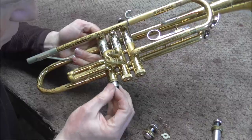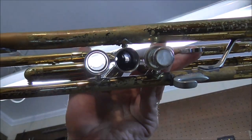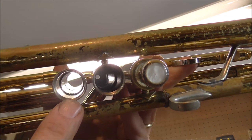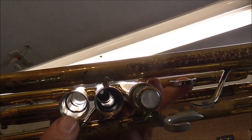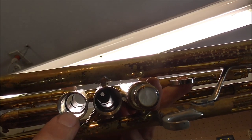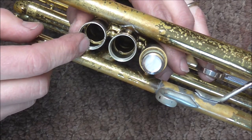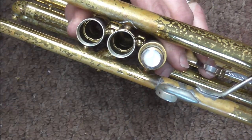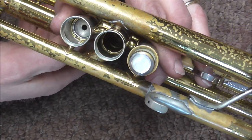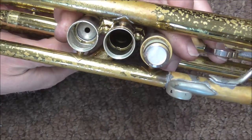It does get stuck. I'm going to point the camera up to the light and show you inside the casing so you can see what is going on. See how there is a larger bore and a smaller bore inside the casing — the larger bore at the top is made so that the valve guide can fit in there. But when the valve guide hits the smaller portion at the bottom, the valve guide catches on that, and the valve guide and spring work together to make the valve go up and down. What I think happened is right at the top of the small portion of the bore, it was shrunk in, and it's interfering with the valve. You can see that the valve goes right up to the top of the smaller portion of the bore, and then it stops.